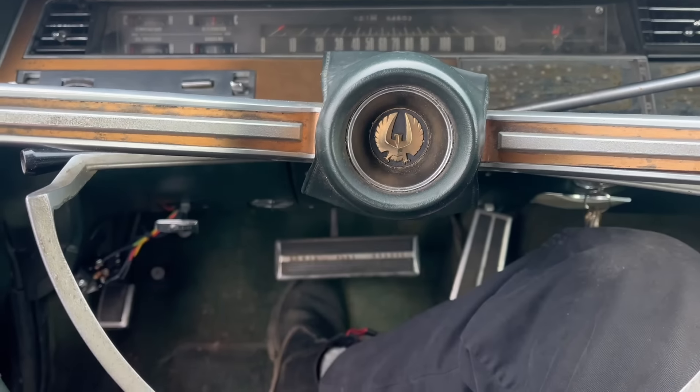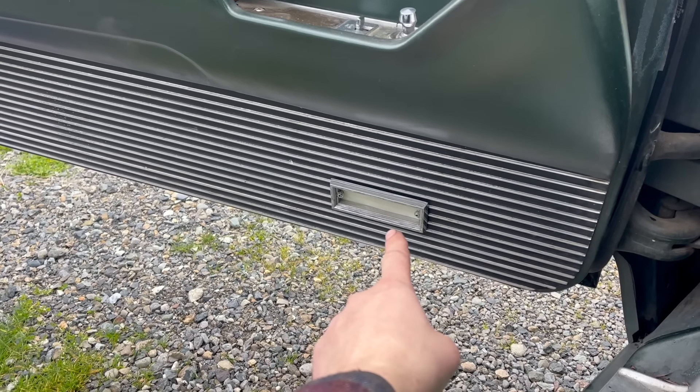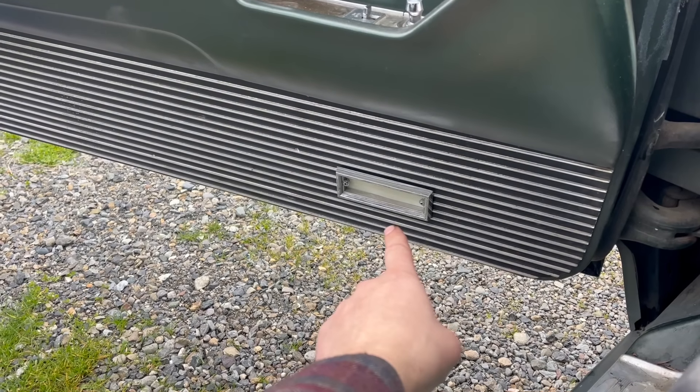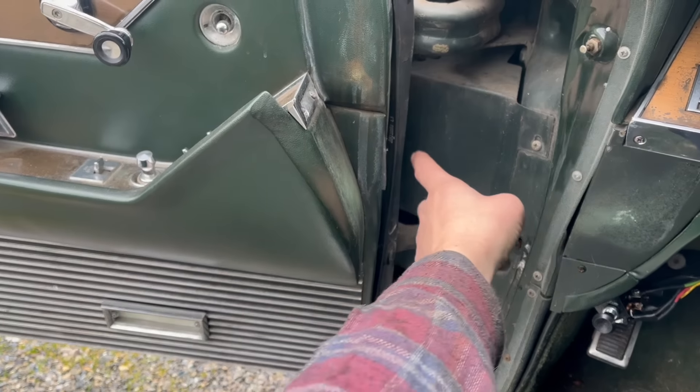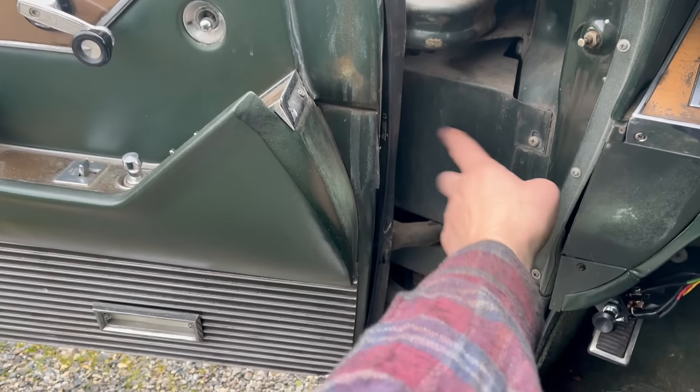More chrome bars — they were really big on the chrome bars on this car. And there's a convenience light, too. You could probably already guess this is a very large car. The interior seating space is quite wide. But look how wide the fender is. There's a cover to enclose that opening because it's that big — you could wedge your whole foot in there. If you know anything about Imperials, you know they're absolutely legendary in the demo derby. Everything is just huge. There's all this extra space for defense.